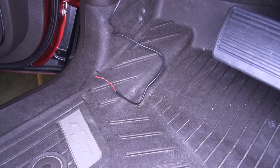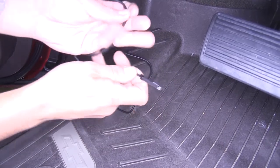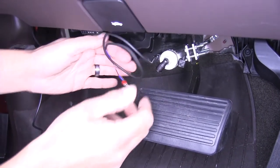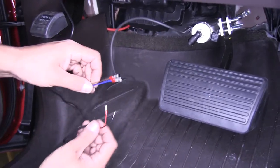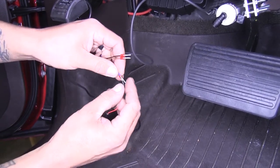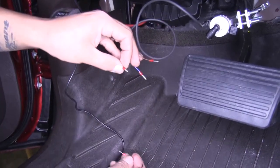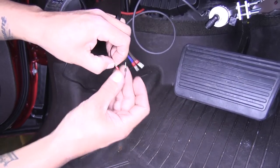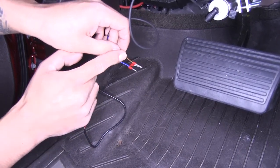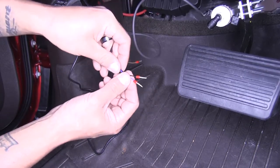I have my wires dropped down right by my emergency brake pedal, and the wires we need to meet up with are coming off of the reed switch which attaches directly to our cylinder. Line it up and push it into place. The color codes for connecting our wires: off the reed switch, the blue wire goes to the black wire but also needs to be grounded separately. The black wire coming off the reed switch goes to the red wire on the monitor light, and the brown wire off the reed switch goes out through the firewall to the engine bay.